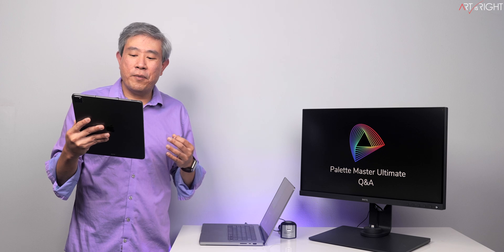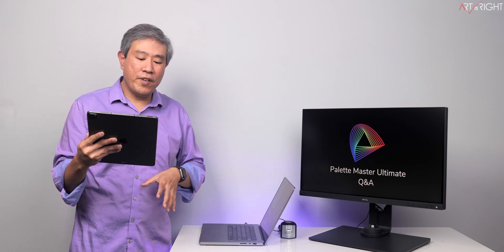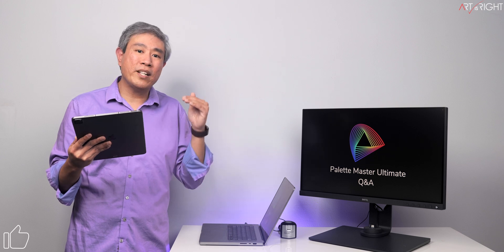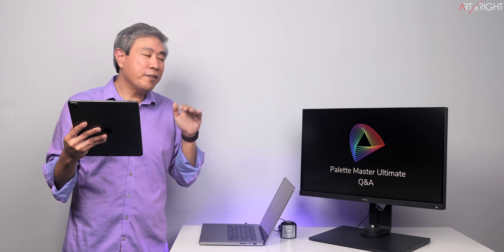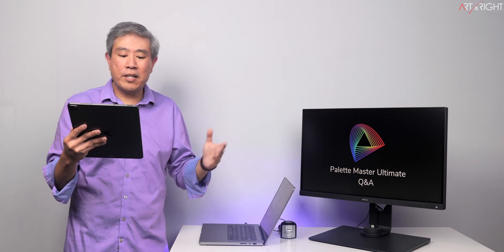In my testing of PMU — is it that much better than PME? The short answer is yes. It is much more stable and much more consistent. Because PMU uses a brand new BenQ proprietary in-house algorithm, the overall delta E's for the calibration on the same display and same computer are lower with PMU than PME, which means more accurate colors. I have displays that are usually under two delta E, but I have never seen my BenQ SW displays go under one consistently — with PMU, I'm able to achieve that. Calibration in color gamuts other than panel native or Adobe RGB, including P3, Rec.709, and D50 proofing, also yields significantly better results. I have been extremely impressed, and I think you're really going to love the experience as well.